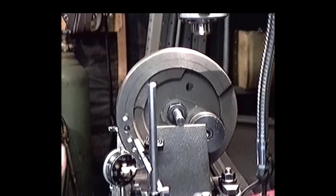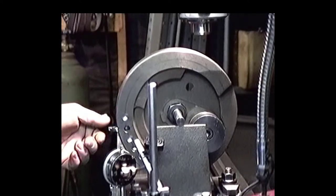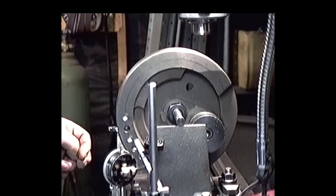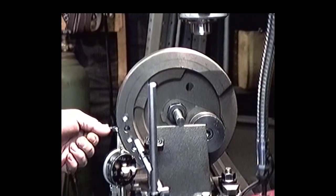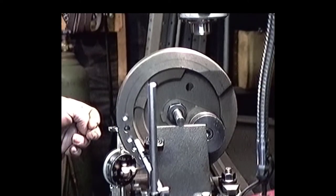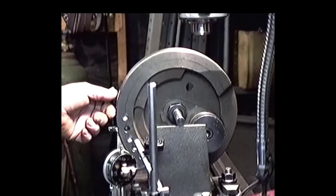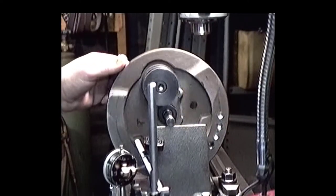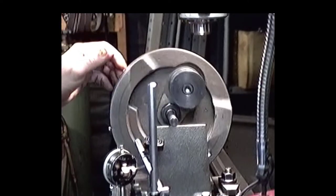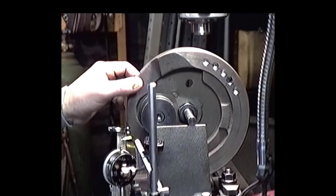Got a right-hand 80-inch Harley flywheel, which is going in a pan head, and we just finished balancing this flywheel to 58%. 58% seems to work out pretty good on the regular stock Harley flywheels. Usually on lighter flywheels like the S&S, we more or less stick with 60%. But when you get through the flywheel like this, it should stay stationary at any point, in any place you put it. I mean, it shouldn't move. You can take that and go 180 or any degree you want, and it's totally balanced.